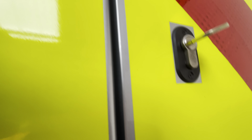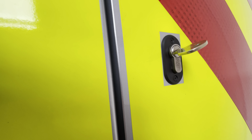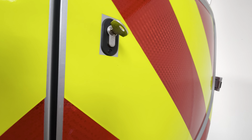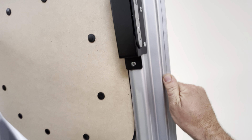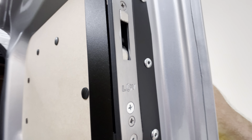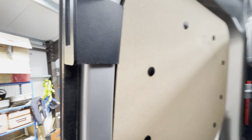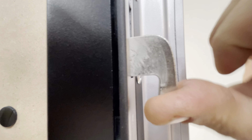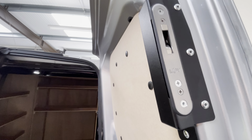You've also coupled that with a suited deadlock in the high position. When you engage that lock you'll just feel a bit of rubbing — that means the hook is engaging nice and tight. When you open the door we aim for zero movement, less than a millimeter. That's our promise to you: if you are getting deadlocks fitted, make sure there's no movement. To get no movement it's a combination of aligning the lock case and also aligning the receiving bracket — adjusted and tweaked down to one mil or less.